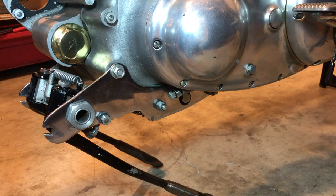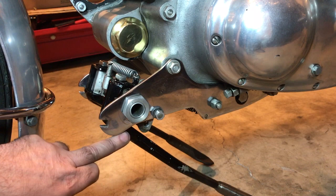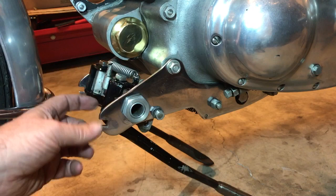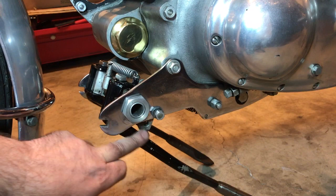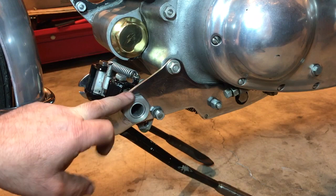And I just assumed, actually, because this was so tight, that it went the other way. What was happening also here, there's some lugs here, and I'm thinking with this not being so tight, it was actually compressing this plate in, and the prop stands wouldn't pass this point here. So no matter how much I lift the bike, they were catching on this plate. So loosening this off a little bit, although it's nipped up, you know, it's not like it's slack or anything, that now allows this prop stand to hit the ground.